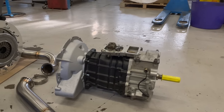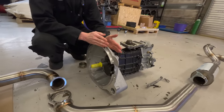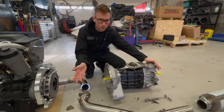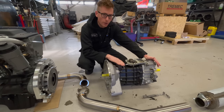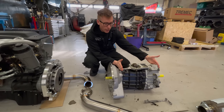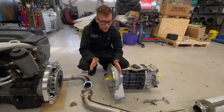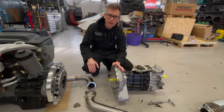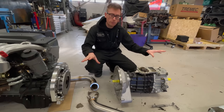The R380 Stumpy is basically a shortened bell housing version of a normal R380, and it fits directly in place of the original LT77, which would have been supplied with your original 2.5 TD or 200 TDI Defender. The LT77 was a bit more old-fashioned and not as strong as the R380, which is why we upgrade it. The R380 in the 300 TDI can handle power quite well — 300 horsepower, no problem — however, the bell housing in the 300 TDI models is too long. So we always say put the Stumpy in, which gets your engine away from the front cross member for a much more professional install. The gearbox stays in the same location, the transfer case stays in the same location, so no messing around with prop shafts.